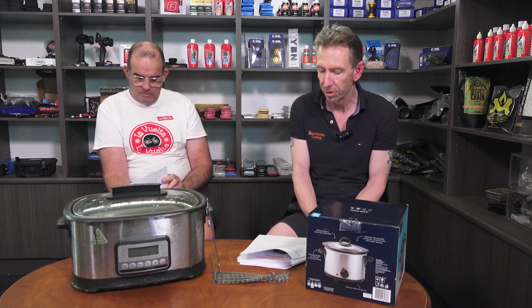Pretty much 9 times out of 10 with 10 to 11 speed chains, if somebody emails through saying my chain's sounding really dry really quickly and I'm sure I prepped it right, it's almost always a KMC chain. KMC chains can be a really fast chain and can get along well with some other lubes, but they do seem to go super dry really quickly with the immersive waxes. On a separate note, SRAM chains generally have really good bonding with wax. SRAM 10, 11 speed chains and SRAM Eagle chains stay really silky smooth for ages on wax, so they feel great.